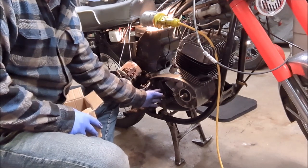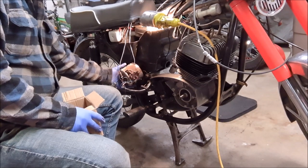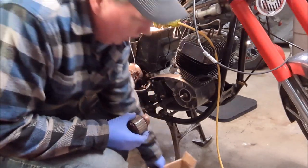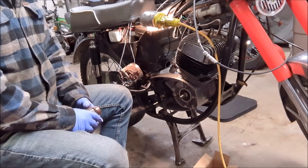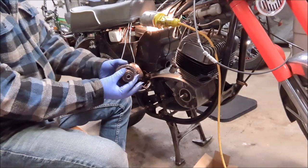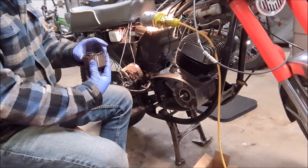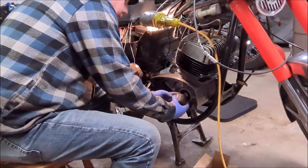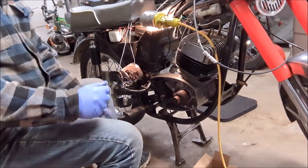The clutch release mechanism is nicely mounted. The next bit is putting the stator and rotor back on. I've got the rotor here in a box. We're going to put that on first, then slide the stator on top and secure it with the stator bolt. This part here is the commutator - it goes against the brushes inside the stator, so that goes to the outside. It's got a pin on the keyed shaft so we need to make sure those line up.